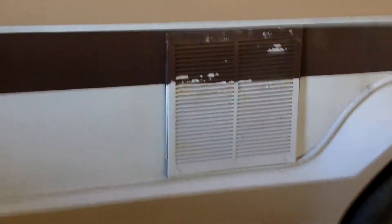I'm gonna cut this panel inside here — it's got the stove and oven, which I'm never gonna use. If I need an oven I'll use my dutch oven on a campfire. So we're gonna open this panel up, get a hatch panel for it, get a slide-out, and put a 3500-watt generator in here, hook it to the fuel tank, and maybe even make it dual fuel and hook it to the LP as well.